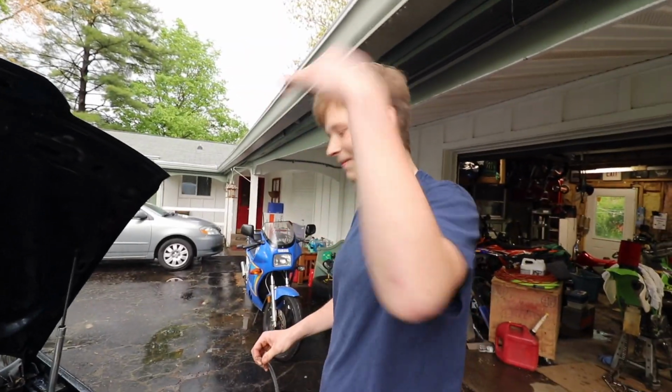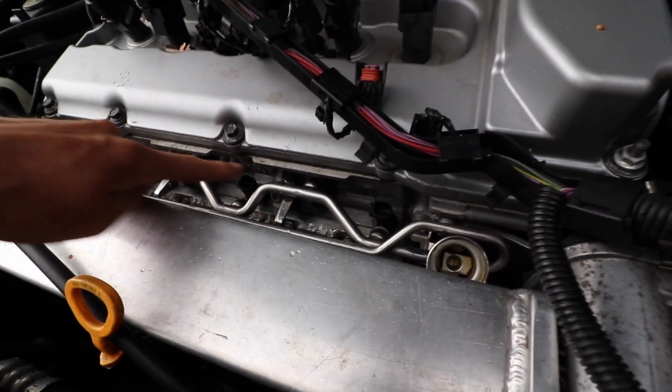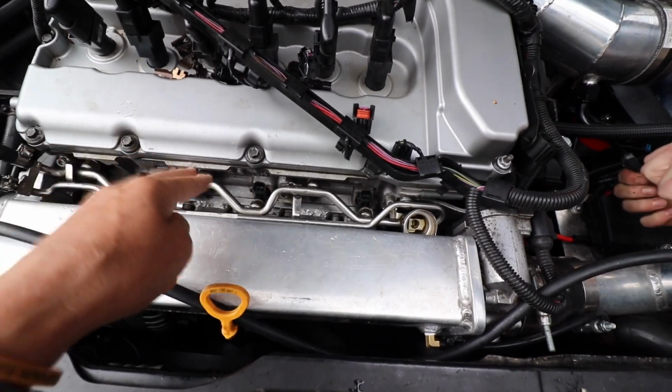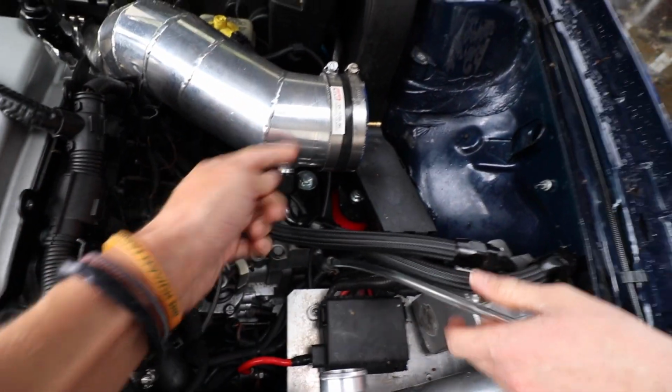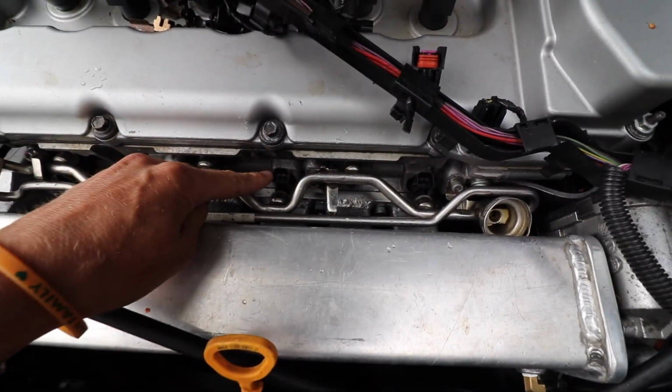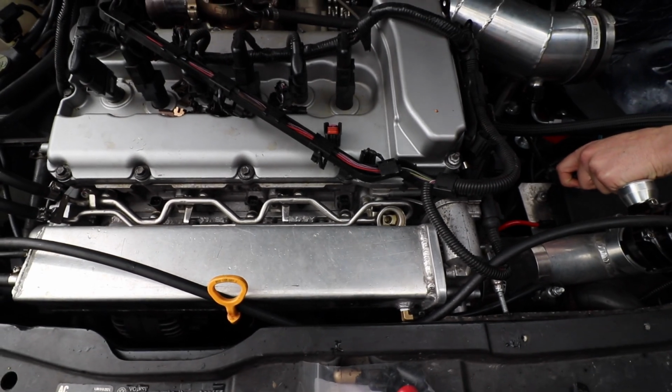I guess. The intake? All right, so Shtick originally thought that his injectors were leaking. Can't really see it. There's a casting, and then there's a vent that comes out of the bottom of this injector. The original fuel system pumps air into the intake, and he had this hooked up to the intake, and it blew all out of the injectors because these aftermarket ones don't have a seal in the right spot.